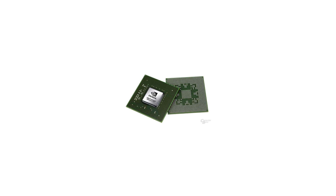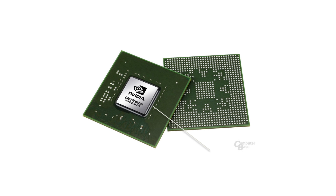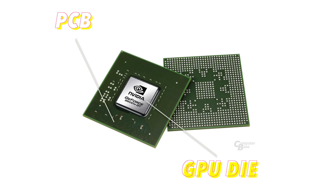This, however, is very difficult, very expensive, and doesn't solve the problem. The actual cause of the graphics card failure is the paste with which the GPU die is attached to the PCB chip, which is very brittle and occasionally does not connect properly. So, how do we fix this issue?